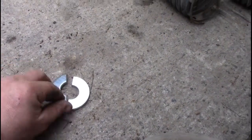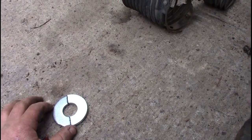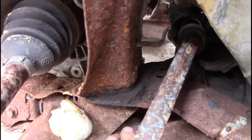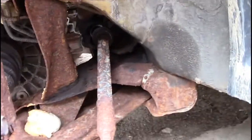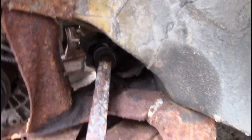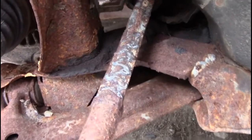And honestly, if I'm allowed to run the solid suspension, I don't really get yelled at at any demolition derbies for doing it this way. There are other ways, like I said. You can weld something on the actual frame down here to the lower A-arm and keep that from being bent down there. But again, in my rules, they consider that reinforcing. As you can see on this car, it's got the tie rods done and the one plate on the K-frame where they always bend, but there's plenty of ways that you can do this.